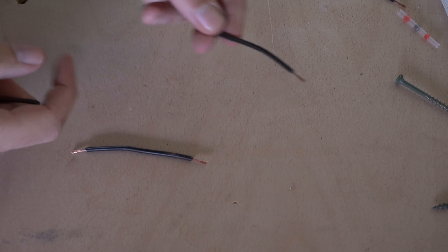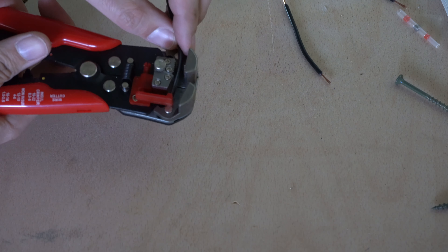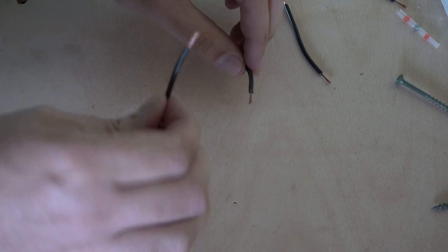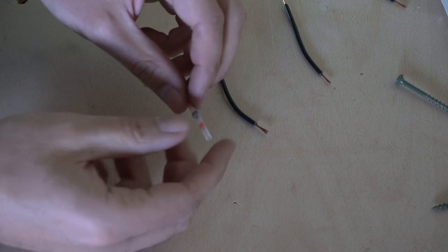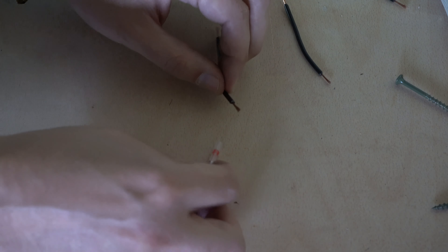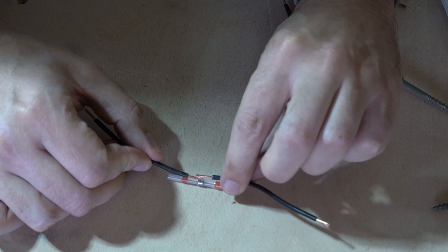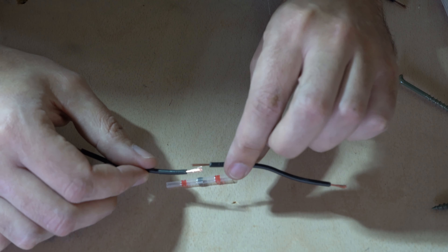I'm making these three-inch extension pieces, trimming the ends off. I could just solder the ends together — so if you imagine the wire in the car, I could just solder the ends. But instead I've found these online. They've got a solder ring already in there and a couple of rings either side. The idea is that your wire goes inside both ends, then you apply heat and that melts the solder onto the wire.